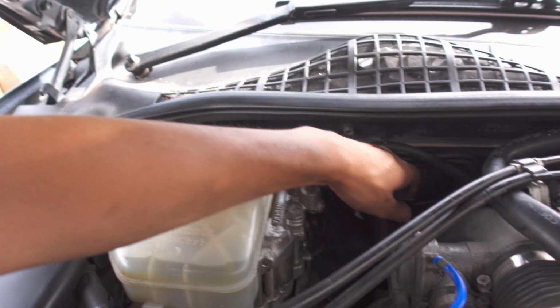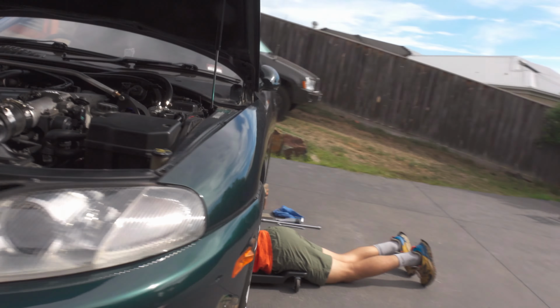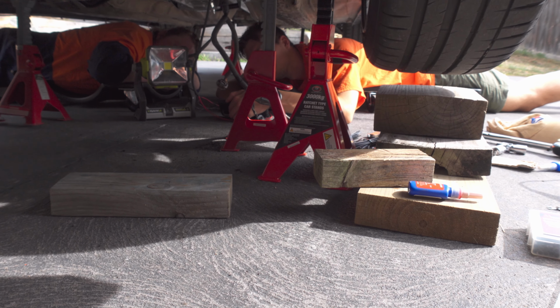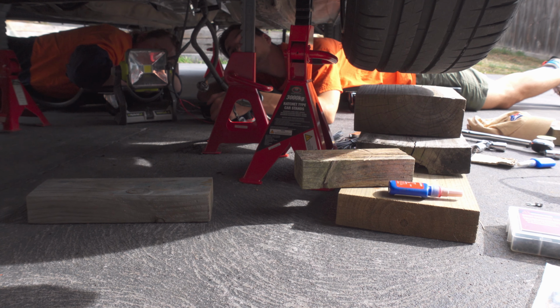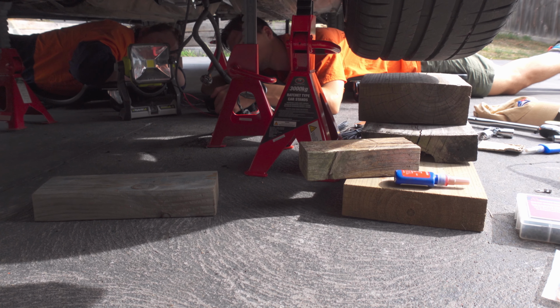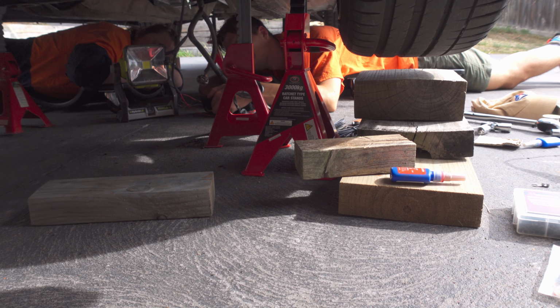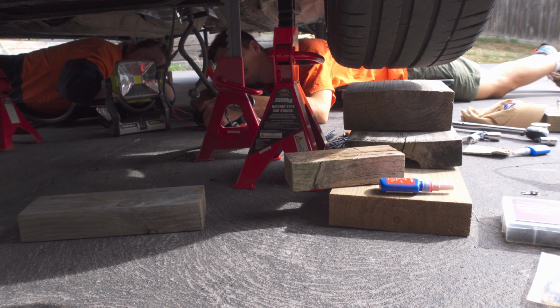I have hooked up the clutch line to the master cylinder. That's now all connected up, ready to be filled and bled. And then basically the last step is what these guys are checking out now, which is the wiring. So just splicing into the factory harness at a couple of points for the reverse lights, the reverse lockout, I think, and the speed signal, and that's pretty much it. After that point, oil in the gearbox and it should be pretty much ready to go.